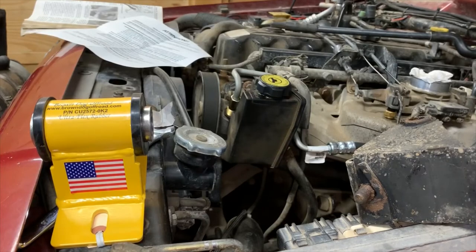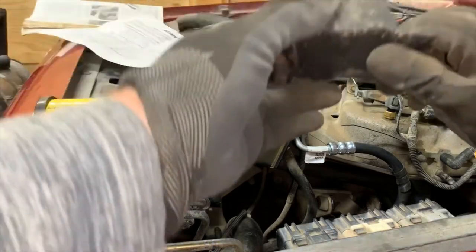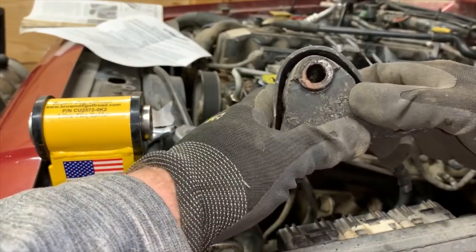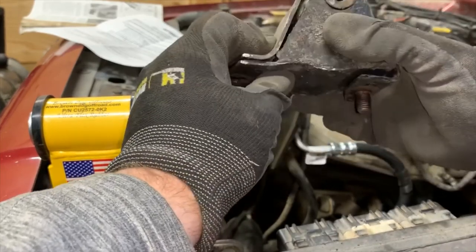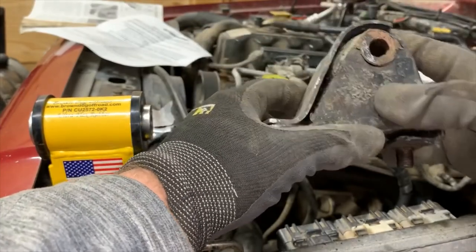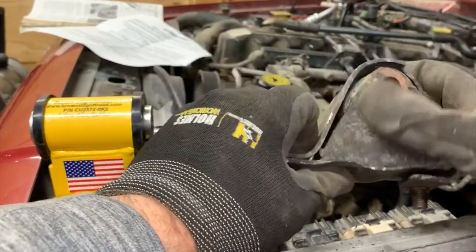Now at this point, I have the motor mount off. It's basically a combination of, I've done these so recently, I used anti-seize on them, so everything was pretty easy to get off, including the through bolt. That one can be a real pain if it's rusted in place, but these motor mounts, I'd be amazed if they had a few thousand kilometers on them. They probably have been in there under 1,000 kilometers, so they are quite new. They don't really look it, that's mainly dirt.